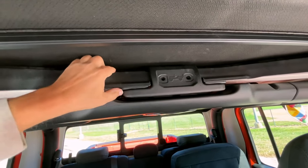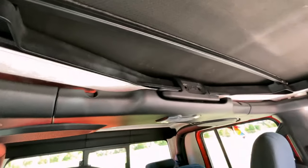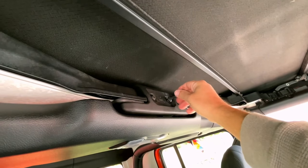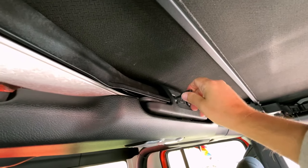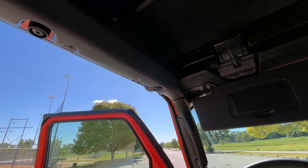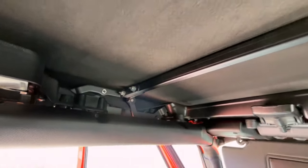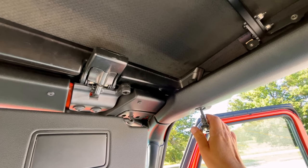Just to give you a peek at what I did there — by pulling down and forcing that foam to squeeze in on itself, it fits in there very, very easy. This next part is equally easy. I just have one bolt here and one bolt right here. It's much easier to just hand-screw this in. It's kind of reassuring just to know that you're running in the threads and you're not cross-threading. So I like to snug them up by hand at first. There is a torque rating on this, and the obvious thing is you don't want to over-tighten it because you'll strip out the nut-zerts that would be inside this top. I've done this so many times over the years — my torque tightening is just what feels right.